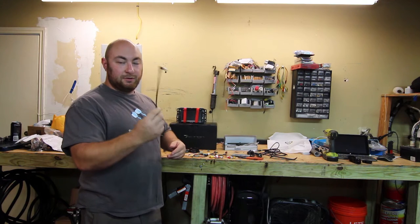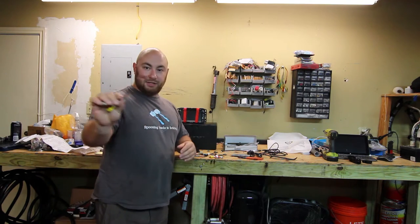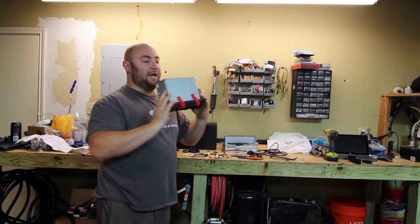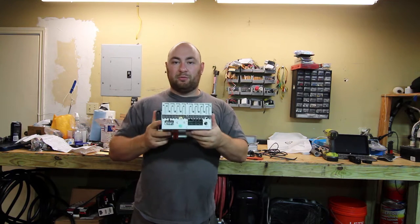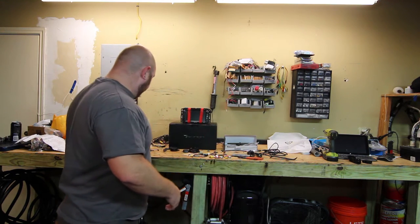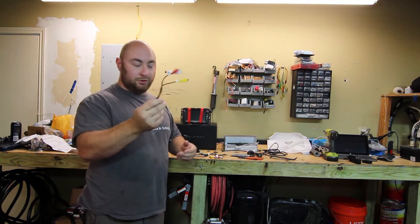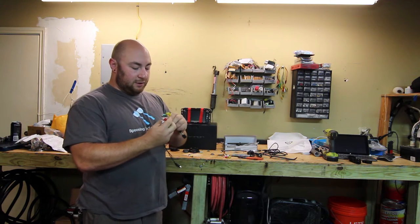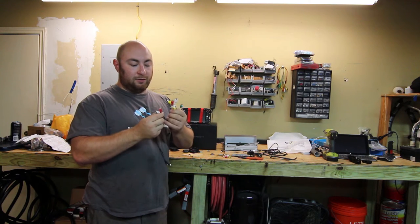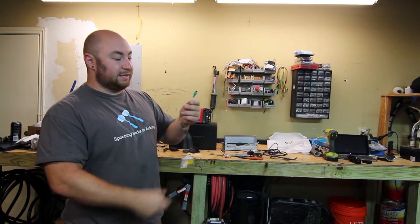There's an adapter that goes from the back of the unit to a GM-style antenna. These units are all modular — if I show you guys the back of the head unit, there are no standard RCA ports, just these little modular digital outputs. To take advantage of that, they have their own kit of digital breakouts: one dongle includes video in, audio in, and auxiliary audio/video input. There's another dongle for all your extra audio — video outputs one and two, rear audio out, rear audio in — for running a separate amplifier. And it's got a single subwoofer output.